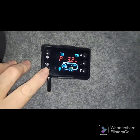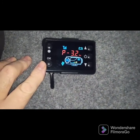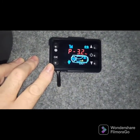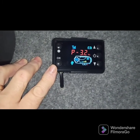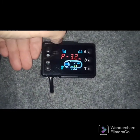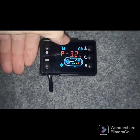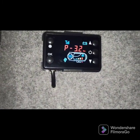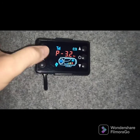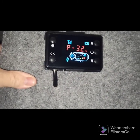It's on full. You can change the settings, but they come out of the factory set for a reason the way they are and they usually work in those settings — I can't see any real reason to adjust them. I mean, if you wanted to increase the pump hertz and raise it slightly, you've also got to raise the fan speed to keep the fuel-air mixture ratio constant so you don't over-fuel it. If you go into the advanced settings and increase the fuel, you've obviously got to increase the air, otherwise the mixture will be running rich and it'll just soot up.